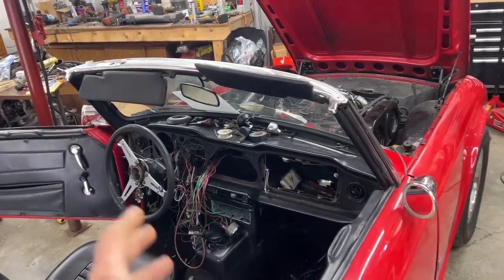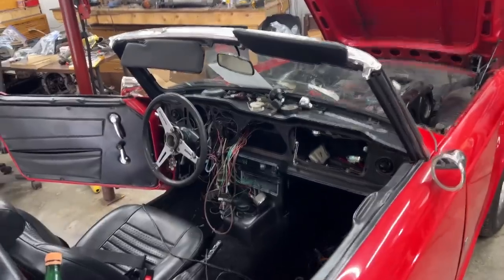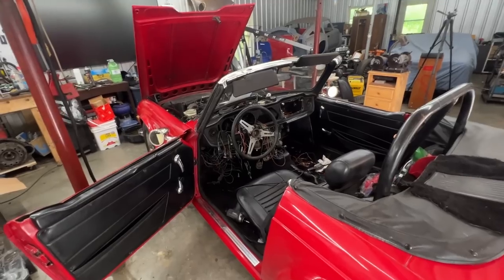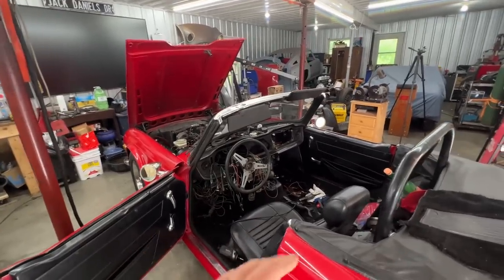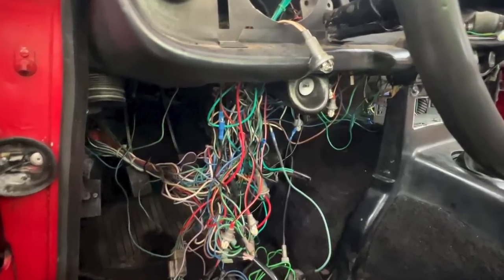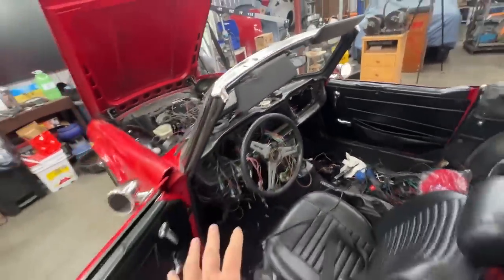We attempted to replace the wiring harness with a brand new one but it turned out it's for a different year, so it doesn't match the switches, the gauges and anything on the dash, so we decided that we were gonna deal with the old one. We wanted to replace the wiring harness because the original one was bodged completely by many previous owners — lots of wires added, replacing original wires or modifying the schematic completely. All the wrapping from the harness was removed and all the wires were tangled into a big bow. We removed lots of wires that were not needed and brought everything back to original — all the original color wires are now running to all the gauges and everywhere on the dash.